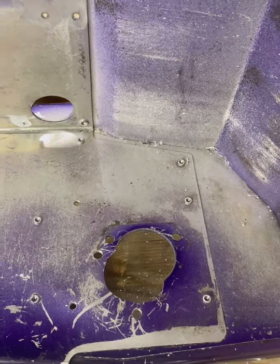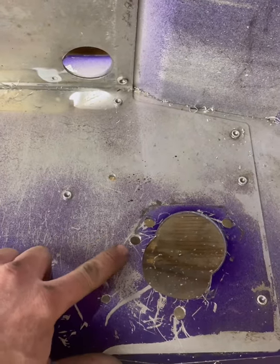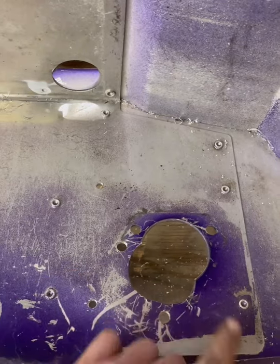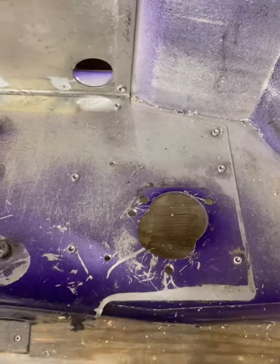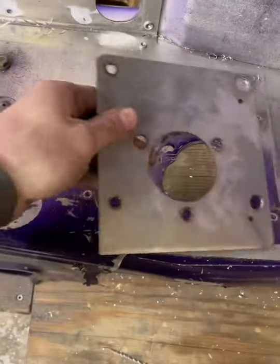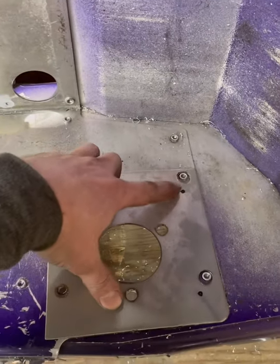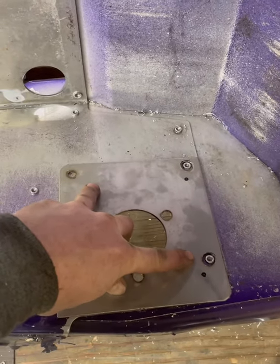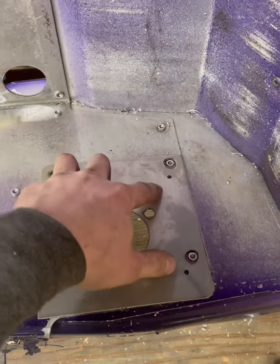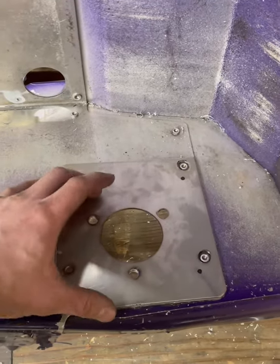You can see that we have the hole opened up here. We did our two locating holes for the bearing plate — right here and here — and opened it up for the template nice and smooth. So we're ready to put on our plate, our fixer plate. This stainless plate goes on this way right here. You can see I opened up these two holes, and I like leaving the factory rivets in the chassis — I just drill two new holes here and here, and that's where we use our stainless bolts to mount this back on.